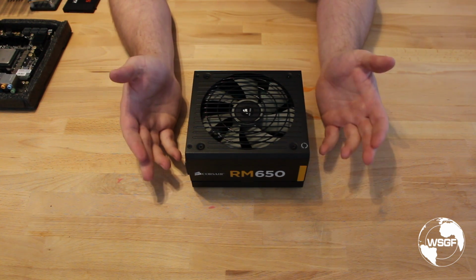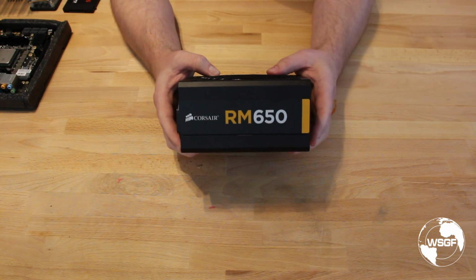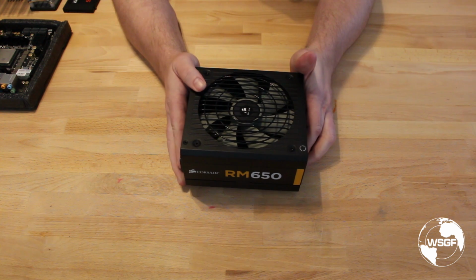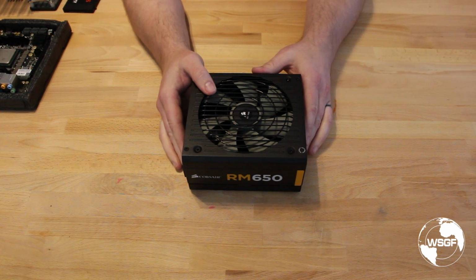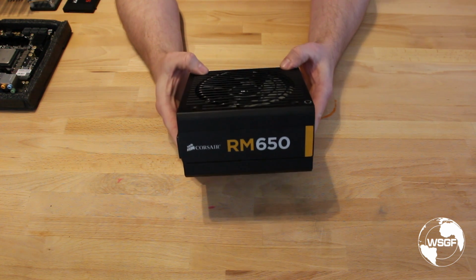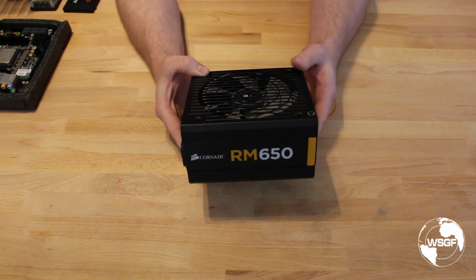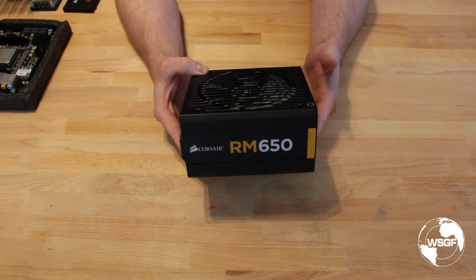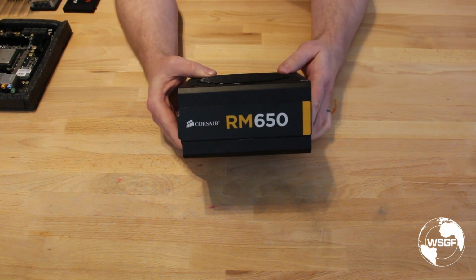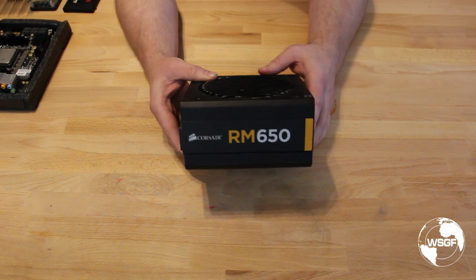And with low noise fans, which Corsair offers a wide range of quiet edition fans, you could have an extremely quiet rig just based on the APU, or with an additional GPU added. That GPU itself would add noise, but it would potentially be the only really noticeable noise in the build. When you're looking at an AMD A10-7850K, I did some benchmarking a year or more ago when I put the first rig together and never got around to publishing it. The unit under full load, with the GPU overclocked to 1 gigahertz, only pulled 115 watts during benchmarking. I looked at Guild Wars, Rocksmith, Dirt Showdown, Torchlight 2, a number of titles that I thought were geared towards this sort of living room PC that I was building for my kids, but it never broke past 120 watts, so it would have been completely silent.